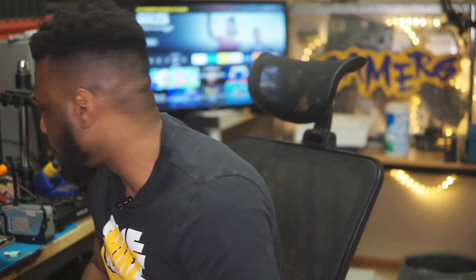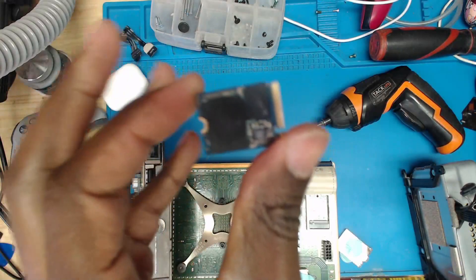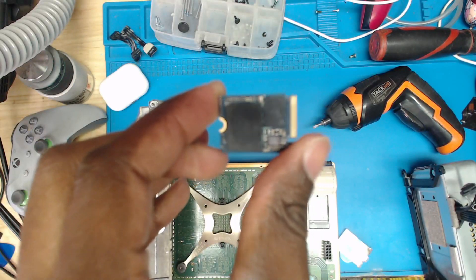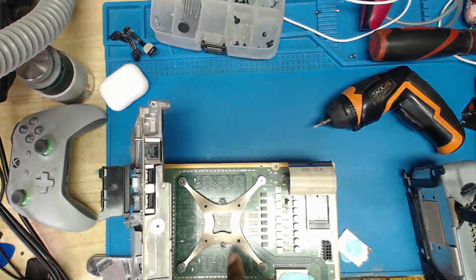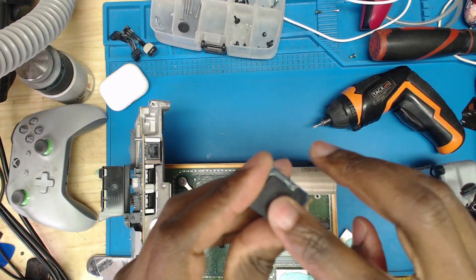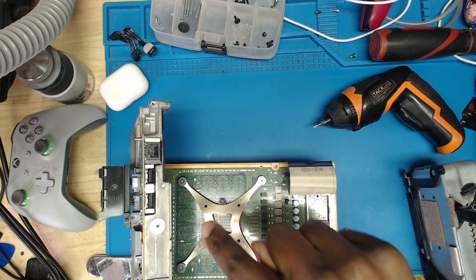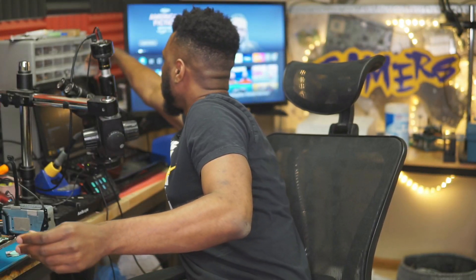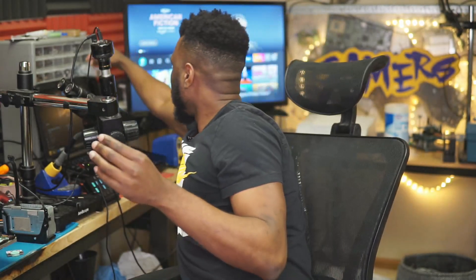This deals with the SSDs. I'll show you guys on the upper cam — I was the first person on the internet to show how to swap an SSD on an Xbox Series by taking the raw partition off the Xbox, because it houses an encryption key that is married to your APU. When you take that encryption key and swap it from this SSD to another SSD, it allows the system to work.